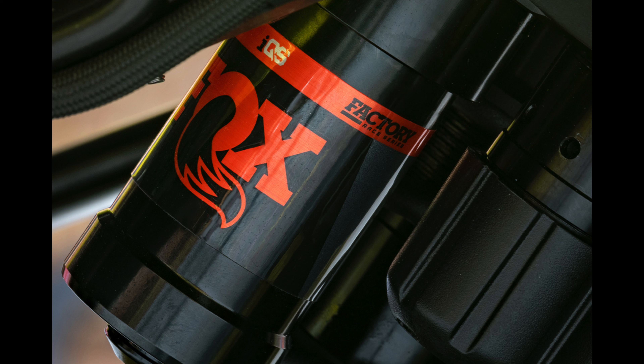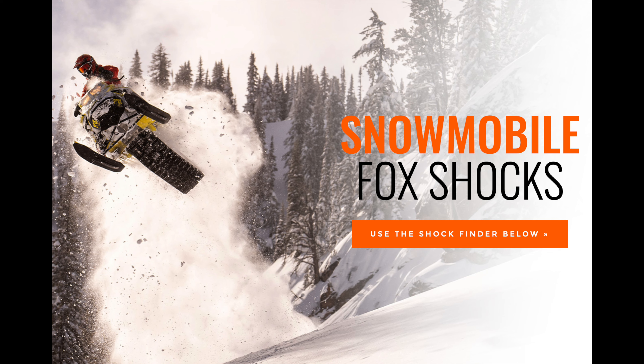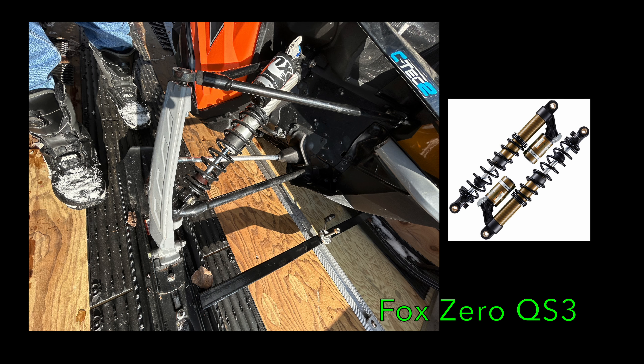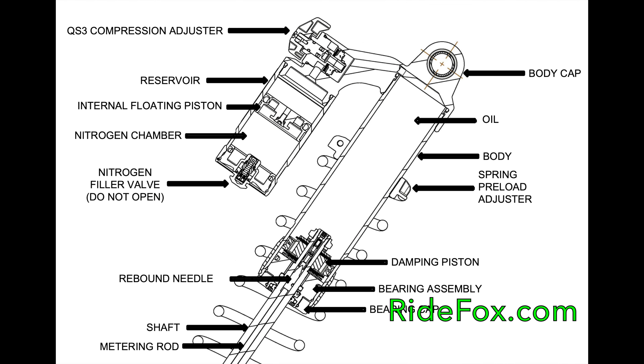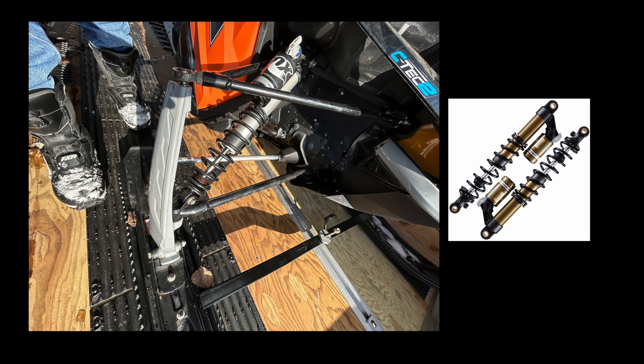If you want the highest quality shocks found on a 2025 Arctic Cat, then look for the name Fox. Fox Zero QS3 shocks have an external reservoir similar to the AC5S shocks. While the shock itself contains hydraulic fluid, the reservoir holds nitrogen gas with a floating piston. As the shock compresses, hydraulic fluid pushes through a port between the main shock body and the reservoir. In this passage is an adjustable valve with three positions — that's why they call them clickers. The QS3s are extremely popular in snowmobiling and ATV circles because they're easy to use: just three settings, a very clear and easy-to-adjust dial. They're very effective, very durable, and they can be rebuilt. They're a very common shock, so there are a lot of shops that can rebuild them.